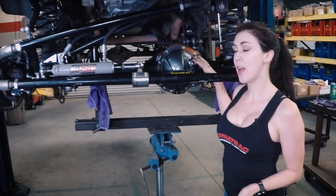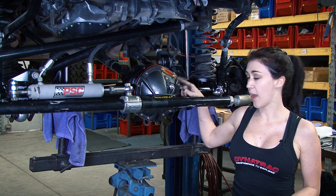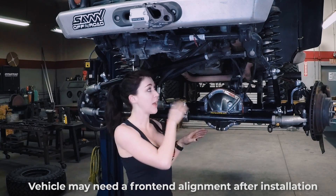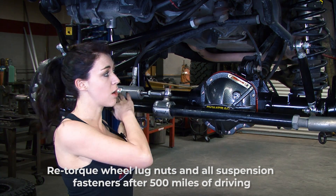Don't forget to put the oil in your axle. On the Pro Rock 44, there are two plugs that you will need to remove. You fill from the top and then when the bottom starts showing some oil, you are finished. Now that we've filled the axle and installed everything else, we're going to put the tires back on, and once it's on the ground, tighten our control arms.